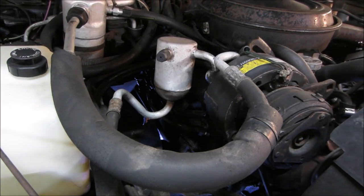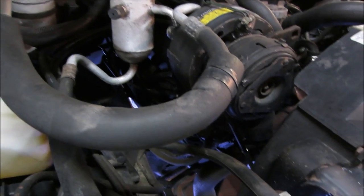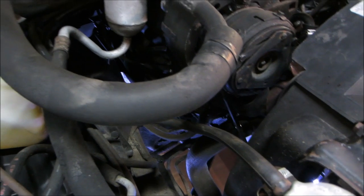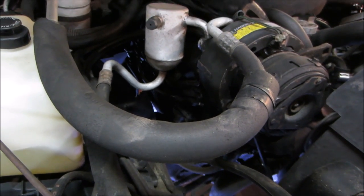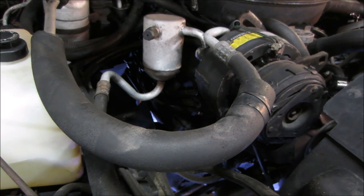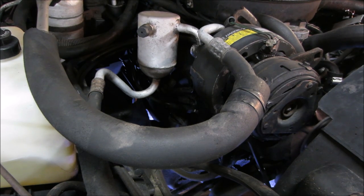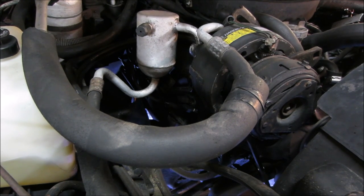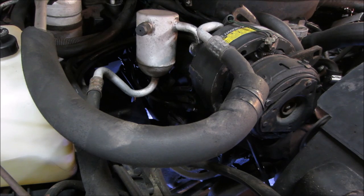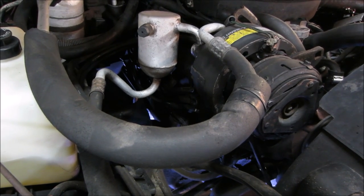we'll leave that side alone, because I think our leak is just on this side. I think I created it. I think the leak originally was the timing cover, which we found and took care of, and then we changed the valve cover gasket. It was glued on before. It had no gasket in it, and now I put a gasket in it, and it only has 5 bolts out of the, I think, 8 or 10 that it possibly could have. I didn't design it. It just is what it is.